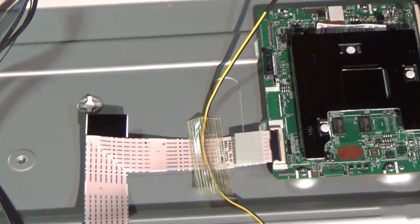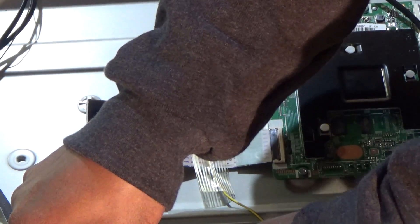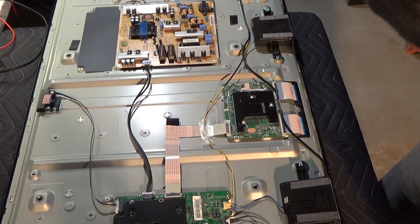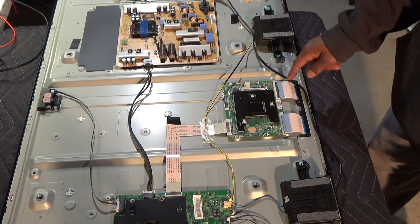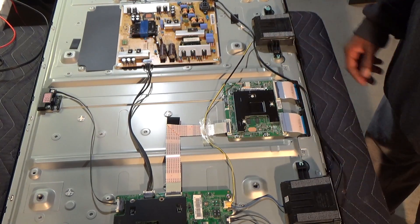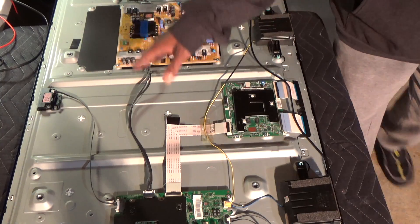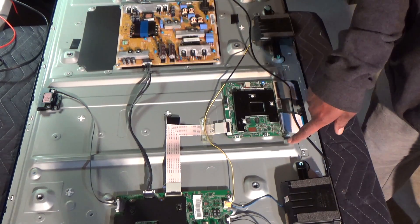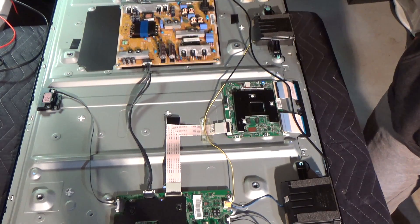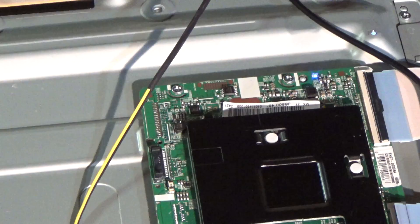I'm going to unplug the TV first, plug that wire back in, then plug my LVDS cable back into my main board. What I'm going to do is unplug these wires going from the T-Con board down to the panel drivers — one at a time. I'm going to try with this one. I'm going to plug it back in. Everything else is plugged in except for that wire. And voila — we have backlights. I can see the backlights through the holes here. And I also notice now we have an actual light on the T-Con board. See that blue light right there? That was not there before. That one light is on the T-Con board, so the T-Con board is working just fine.